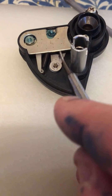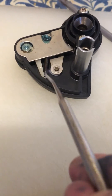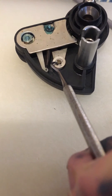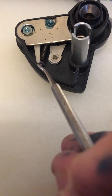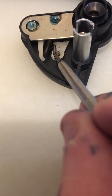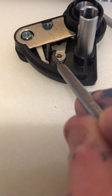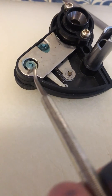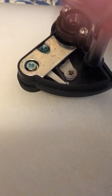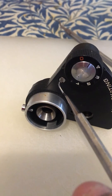This pivot point connects to that lever. Perhaps a little lubrication here might improve the functioning if it has become stuck or gummed up. But the most likely candidate for the anti-skate being wrong is that this spring perhaps has become detached. If you got this far — you'd obviously have to take the tone arm off by removing this nut and screw on the other side — you probably could ascertain whether that's the case.